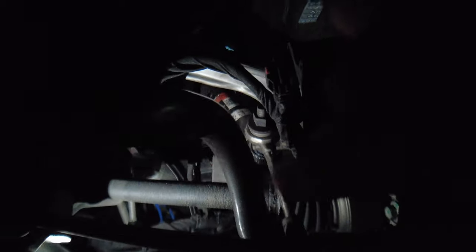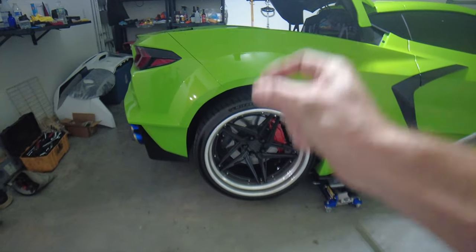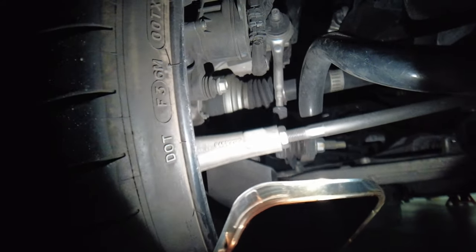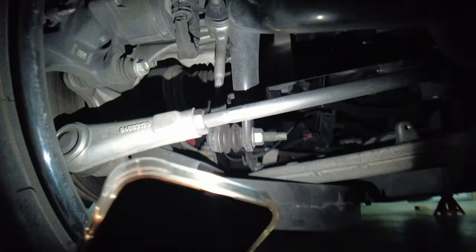If you look up under here, you've got your tire and wheel, and then in here — I'm going to zoom in because it's kind of hard to reach — you'll see the bottom of the shock absorber right there. You'll notice it looks pretty greasy, very wet-looking, a bunch of gunk all over it, and even on the axles it's all dripped down. That's what you're looking for to identify a failed shock. That one's been done for a while. We figured it out because we saw a few drips of fluid on the floor and matched it up. Now let's jump to the driver's side — everything is bone dry over there. We are good on the driver's side; the passenger side rear is trash.